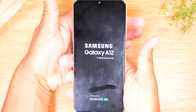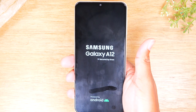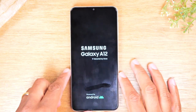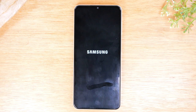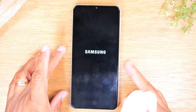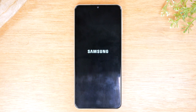And there you go — it actually happened super fast. The phone shut off and I continue to hold the buttons, and that prompted the phone to restart. You can see it's already in the process of restarting. You just need to give it maybe about 30 seconds or so and it should be ready to go. Usually just a quick soft reset is all you need to get the phone to restart itself and fix whatever problem is happening, and your screen should be responsive at this point.